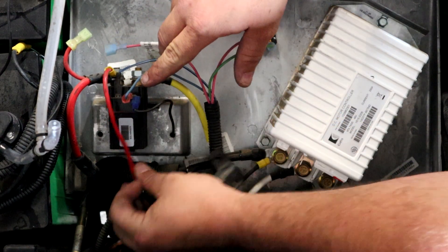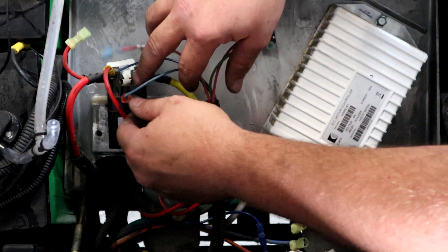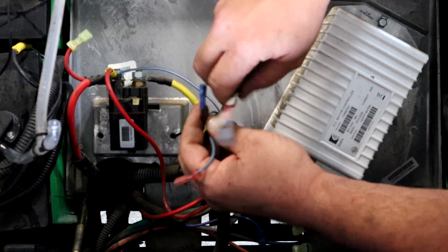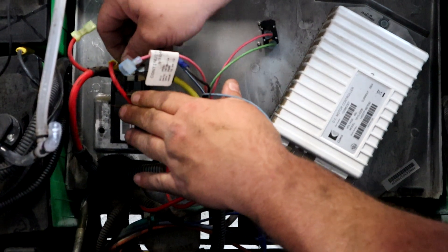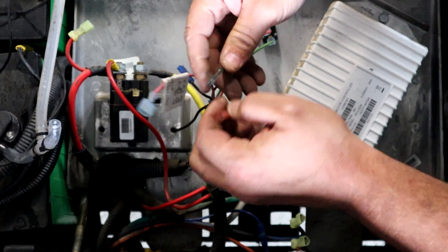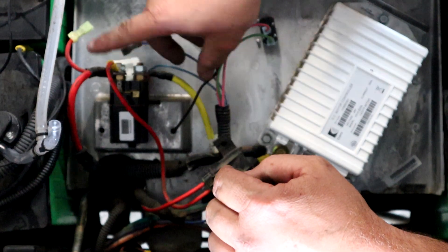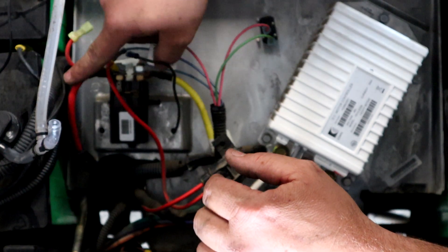They have another wire running to the activation switch on the solenoid — your cart probably won't have it. When you go to do your activation wires, it's going to be a light blue and a blue with a white wire. On an MZJ it doesn't have spade connectors, so you will need to clip these and put small ring terminals on it. Also remember you will have to reuse this red wire. We're going to put it in a ring terminal and replace our main cable.